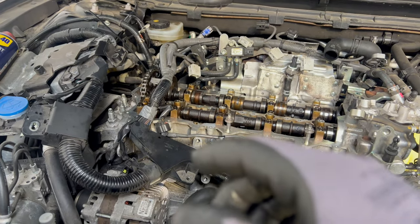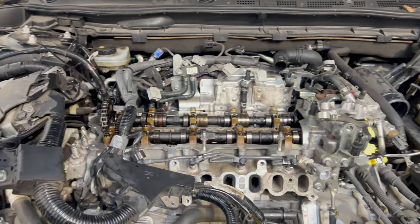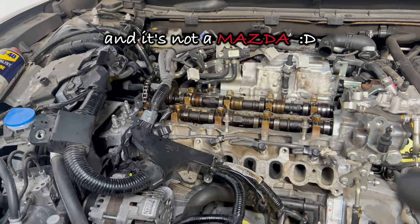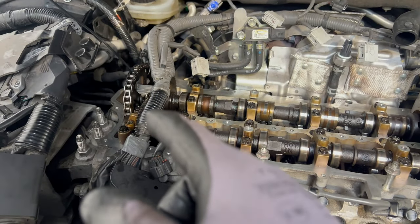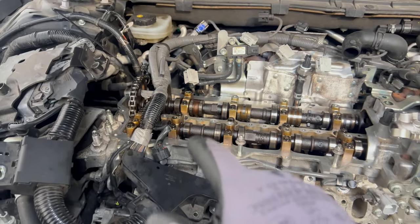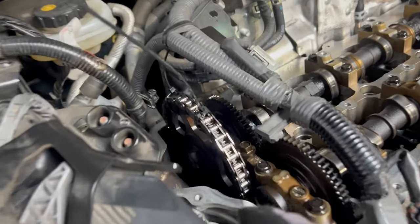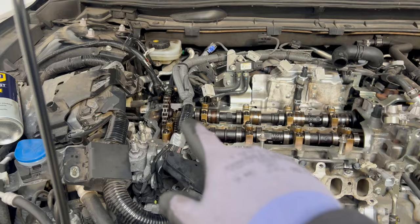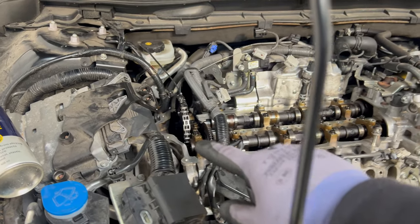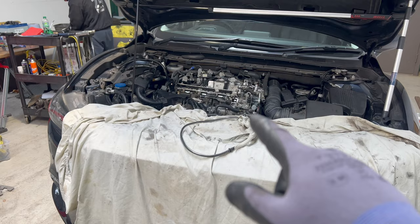Dan is picking up a car - helping the driver since it was towed on a trailer, helping unload it. I'm going to do this reassembly on my own off-camera and show you once it's back on. The bolt is in, I can cut the zip ties and tighten down that bolt to 230 Newton metres, and then the valve cover can go back.